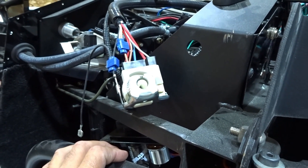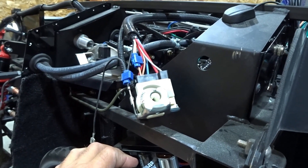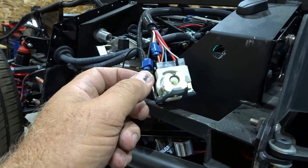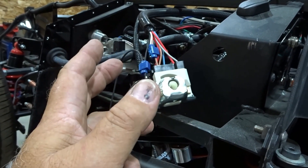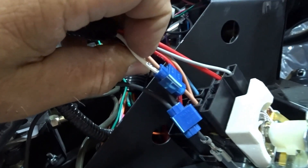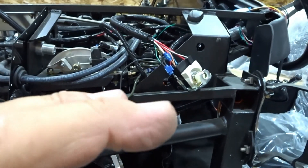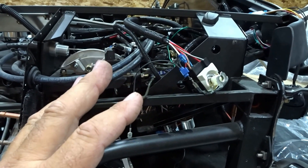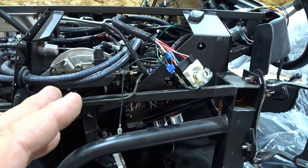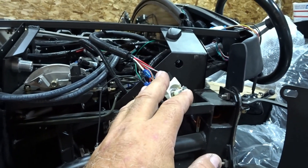What the headlight switch rheostat will do is turn the dash lights off at a certain point when voltage drops low enough — the LEDs just go out. I see more problems with guys saying their dash lights all of a sudden don't work. The problem in most cases is that the dash rheostat has been turned over a series of uses turning the headlights on and off, and you don't realize it. So what we do on builds using Speed Hut gauges is we take the dash light wire — the white wire — and tie it into the tail lights or parking light circuit. That way, when the headlight switch is pulled to the first click, the dash lights get full power, not through the rheostat. You avoid having a conflict of trying to control them at two locations — the Speed Hut dimmer and the dimmer built into the headlight switch. So we bypass that.